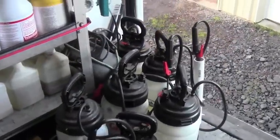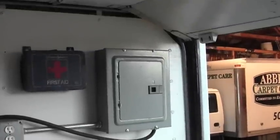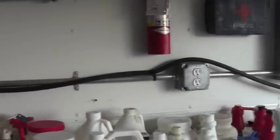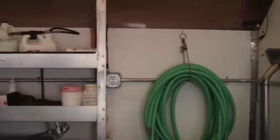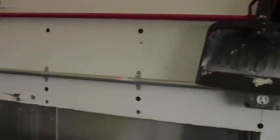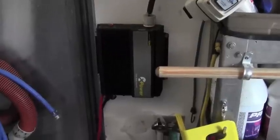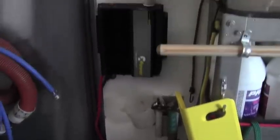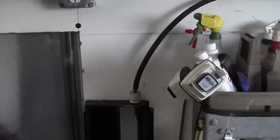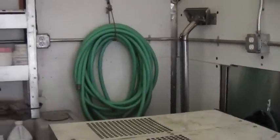Inside, we try to keep somewhat consistent with the other vans, but this is something that was interesting — it had a circuit panel in there with 5 circuits with 110-volt plugs all the way around. I decided to go ahead and keep that in there and use it. I found a great deal on a 2,000-watt converter and got a used battery, so we put that all together. It works fine, especially if you're at a customer's house working on an area rug — it's great to pull out a fan and start drying without having to run extension cords.